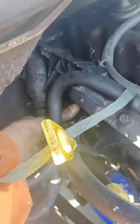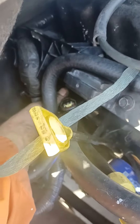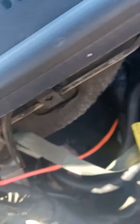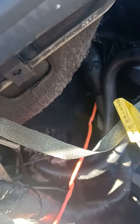That wiring harness — on this one at least — was taped to the adjacent harness and you had to kind of pull it loose. It feels like there's two of them together, but there's not. It's just taped and it comes loose pretty easily, at least mine did. Once you have it fed through like that, you should be able to pull your string through and get that tail in place where it needs to be.